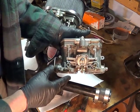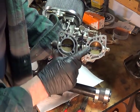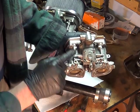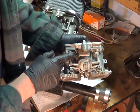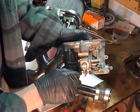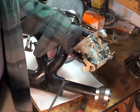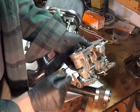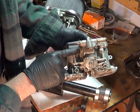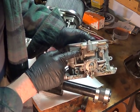I'm just talking about what size the carburetor is, what the different screws are for. You change the jets to adjust the idle, and then there's carburetor speed — that's just holding the shaft open a little bit. The main place for problems on these things is right here in the idle jet, and people just don't know where it is. They take out the needle and blow, but this is where they should be looking — up here, higher.